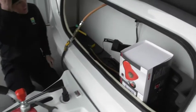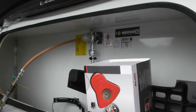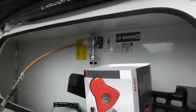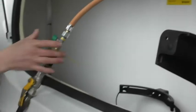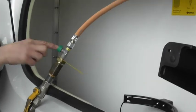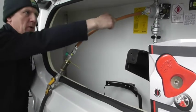Gas — this will look slightly different, unless you've had a duo control, obviously connected to your last van. This being the special, our special, which is a Celeste, has a duo control regulator, which has got extra safety devices on to start with. So you've got that there, that releases the gas. So that is actually, if you get a burst pipe, that will recognise that and shut off. When you start up, you need to press that to put gas into your pipe.